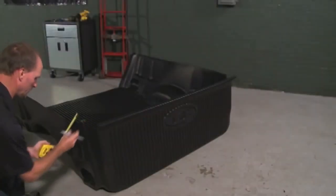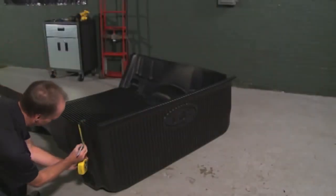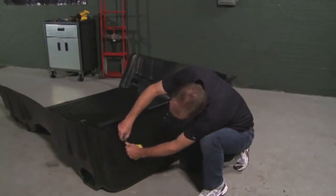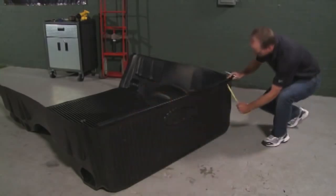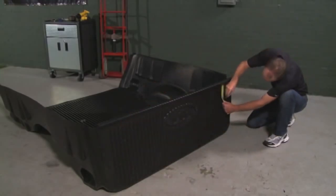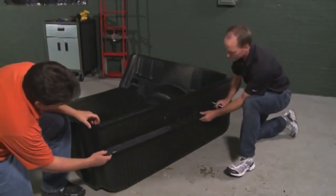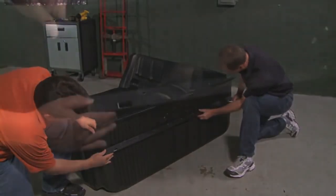If your truck has a plastic drop-in bed liner, you'll need to remove some of the bulkhead portion. Here's what you need to do. Beginning 5 inches from the bulkhead panel, mark the depth of cut on the bed liner. This depth will be equal to the depth of the Roll-N-Lock housing you're installing. Then use a straight edge to draw your cut line.